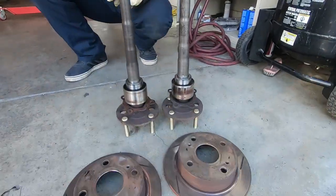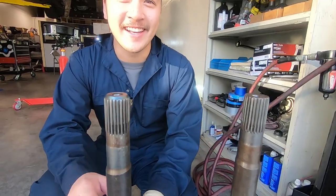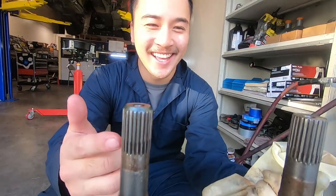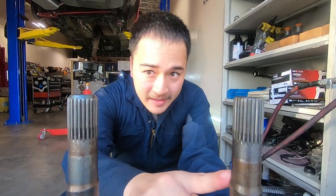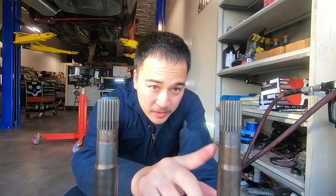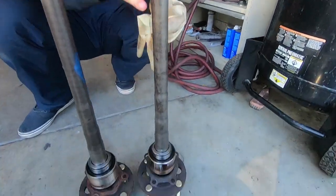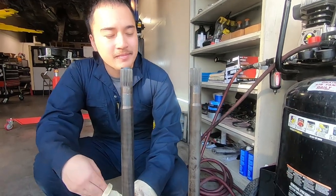All right. I told Chris to clean the axles too, get all the crap off. What did we notice? It's funny because I was just asking you about the difference between non-LSD and LSD axles, and mid-conversation I realized that these are two different axles. As you can see, this one has a straight cut, not much of a bevel on it, and this one has a bevel on it. One of them should be longer than the other one. Yeah, this one looks a little longer. I never noticed. I wouldn't have known because I've never taken it apart, but the previous owner replaced this axle. So one of these is LSD, one of these is non-LSD axle. Now you guys know.